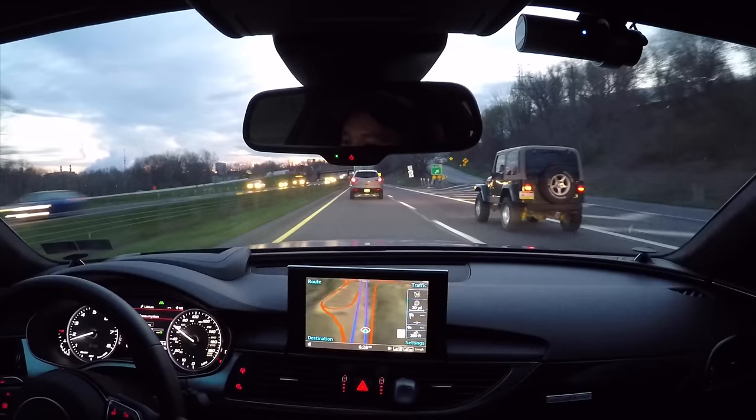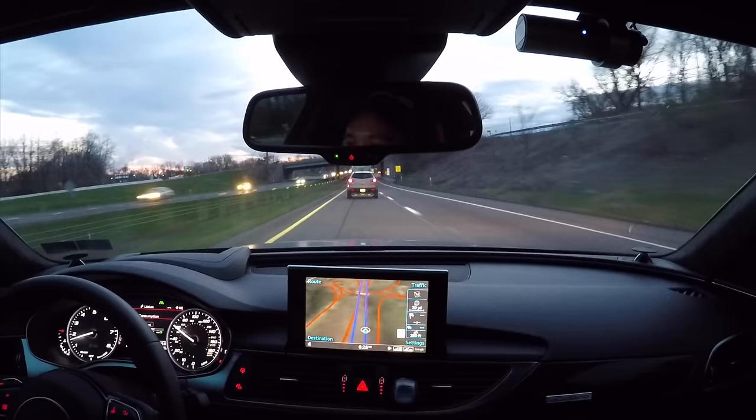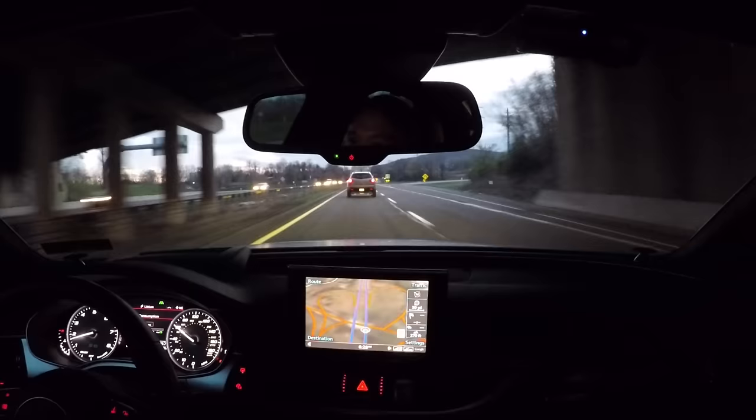Right now, I currently have the launch control RPM set at 4500, which I think is too high. So when I get to Redline, I'm gonna have them lower that to 3500, or whatever the next step down is, which should help in traction.